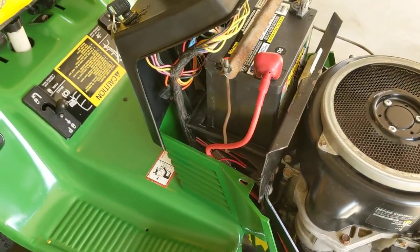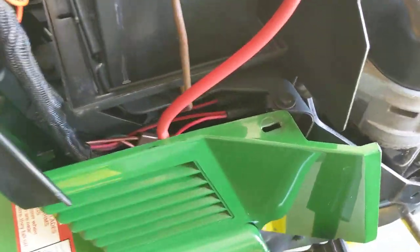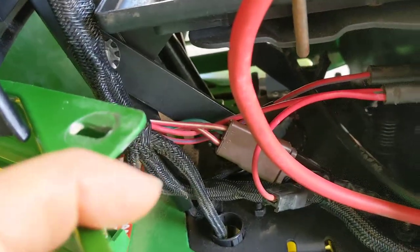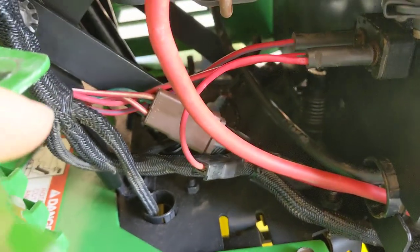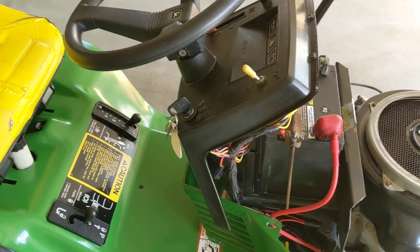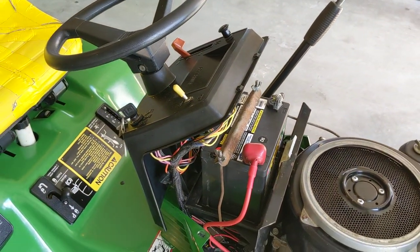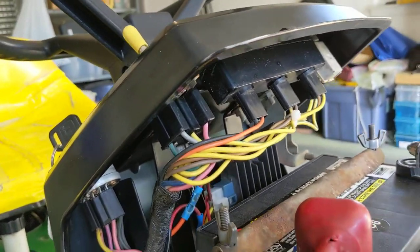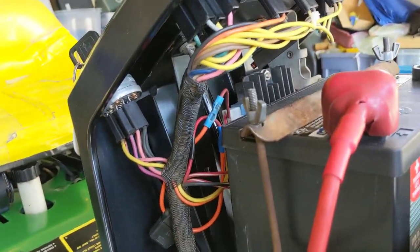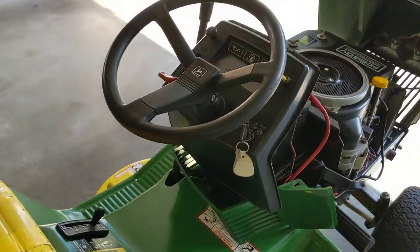Support straps too. While I had it apart, I painted all in here — the battery deck and the pedestal. Not painted, but rust-prevented it. Compressed, installed, and lubricated the new compression spring and steering gear. Disassembled, cleaned, and de-oxidized all of these wires and plugs — took all the plugs apart; they were in pretty good shape actually. Then had to reinstall the whole dash assembly, steering wheel, and steering column — all of that.